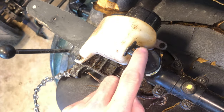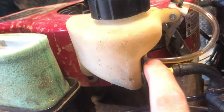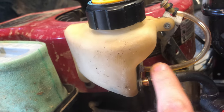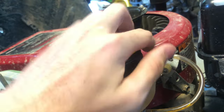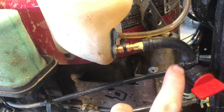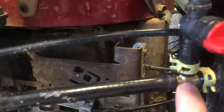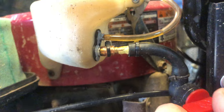Since this was on the gearbox, this was the pump that would pump oil to the chain, but with this I basically epoxied that shut, just ran a tube up here, put a screw in here. This bottom part where the fuel line comes in — it's quarter inch fuel line — runs to a little T, and there's a standard on/off switch right here.